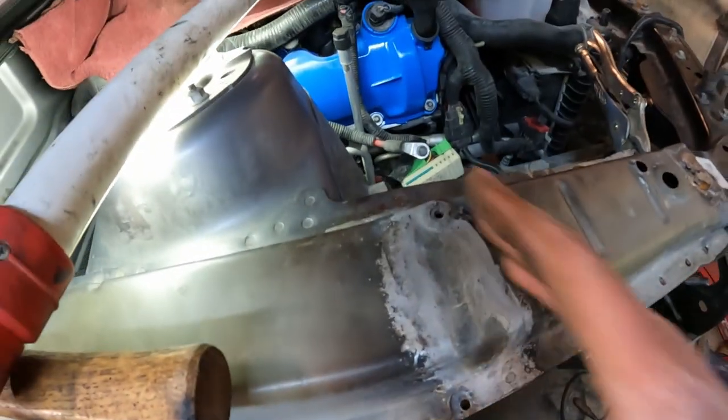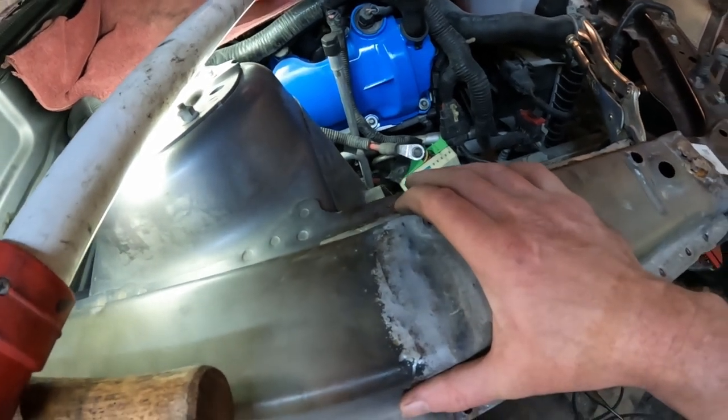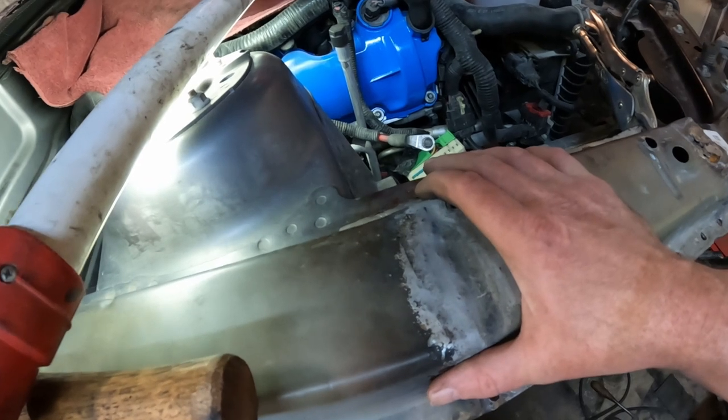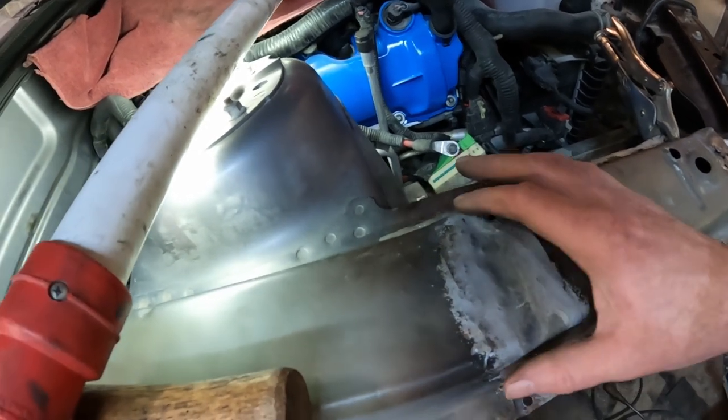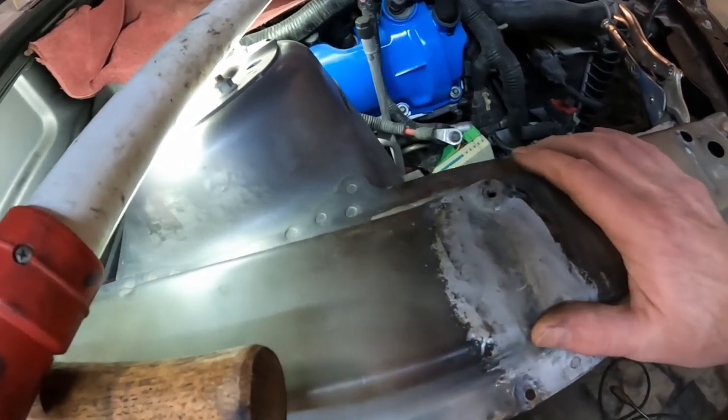They would call that sectioning, and generally that's frowned on. I've seen guys that will try to section and put a sleeve in and weld around the sleeve. In years past, that was kind of a thing, but that's not a good repair. I wouldn't suggest anybody do a repair on a unibody car like that, because you've compromised the structural design of the car that way.